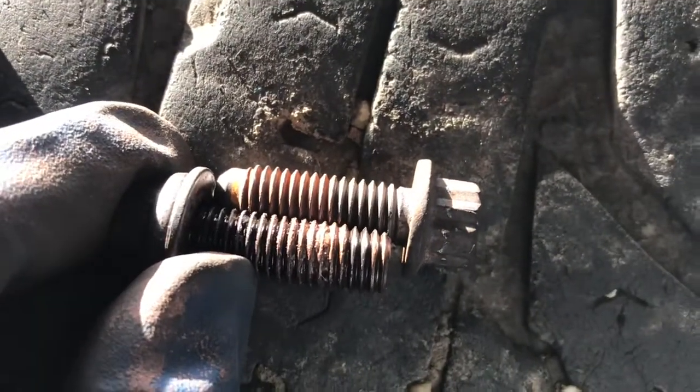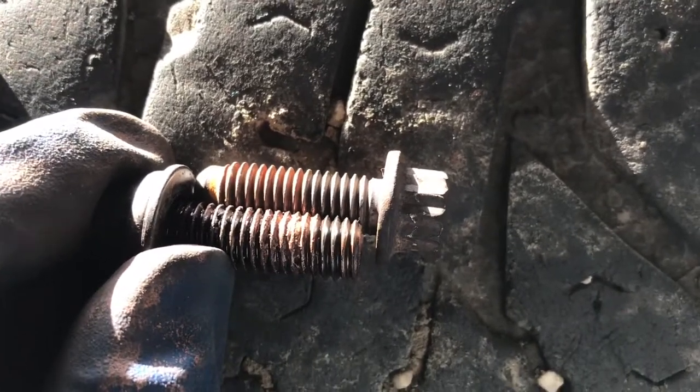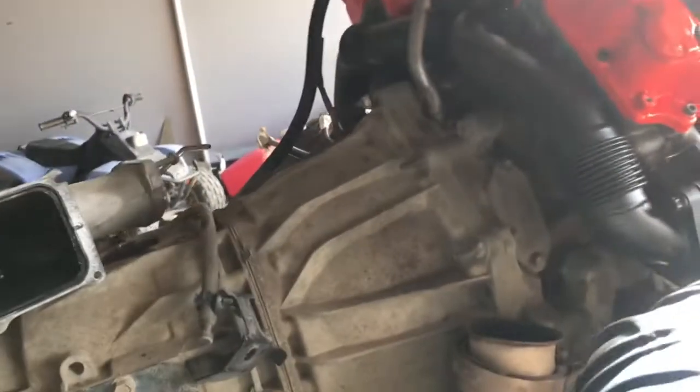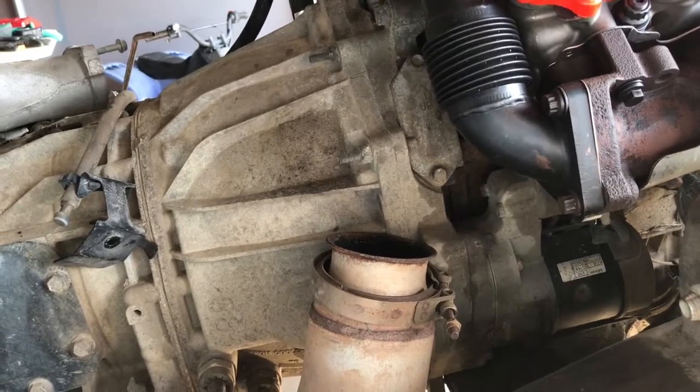So on the driver's side I just used all original bolts. On this side I swapped the bottom one out. ARP's got a washer behind a nice clean bolt, but it's still that much too long and it will not tighten the gasket - I tried, you really torque it and it still doesn't touch the gasket. I grabbed extra washers and put them in, but that was a shady way to do things, so I went back and swapped them out with the originals.